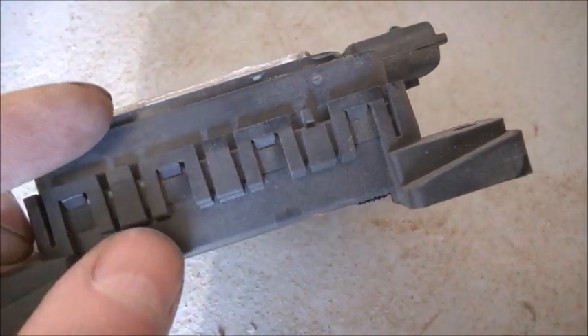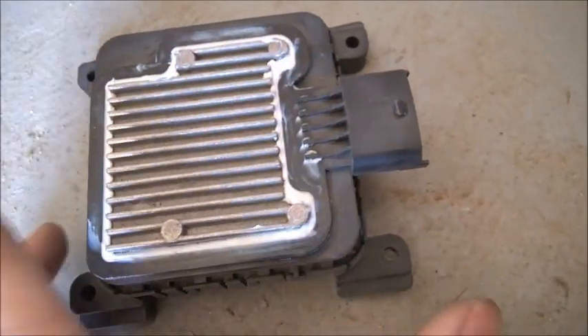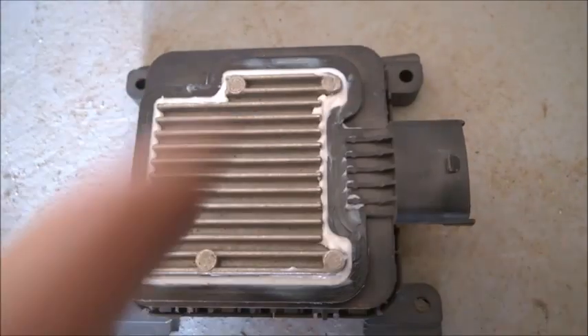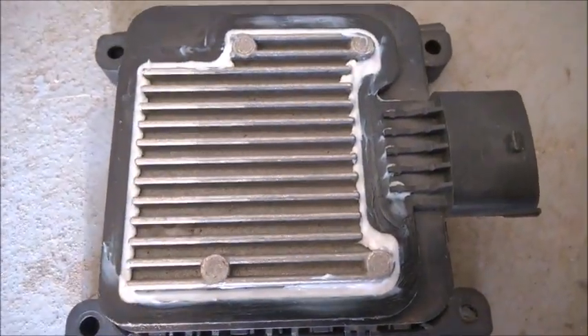Just open it a little bit. There's also a seal all around, but that's not a problem — that seal is in very good condition. The real problem is here at the top, especially as this sits like that and water accumulates, corroding the metal a little bit. That metal is glued to the plastic, and that glue fails and starts to leak inside. Applying sealant will keep it good for a few more years, if it's not already too badly damaged.